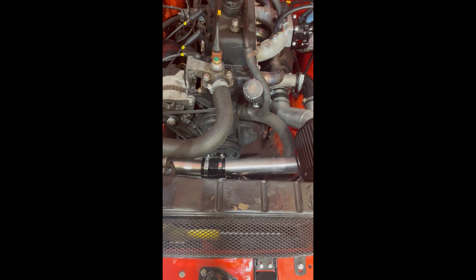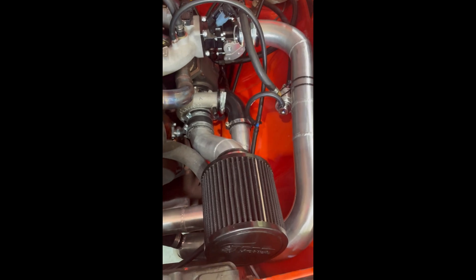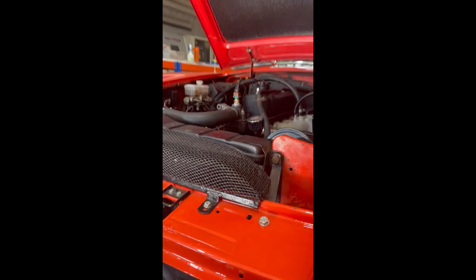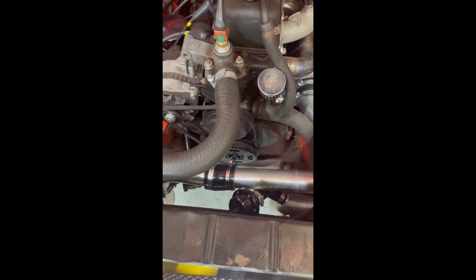On the late cars with the radiators back here, we've chosen to route the intercooler piping down and just under to the valance, where we have an intercooler sitting under the valance. The pipes come through and under, and the pipe sits underneath the arm — the arm being the lowest part of the car. We did this so that it's easy to mount on existing points under the car where the cardboard shield would normally go.